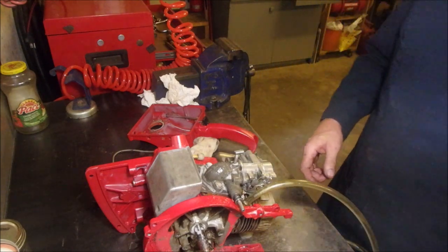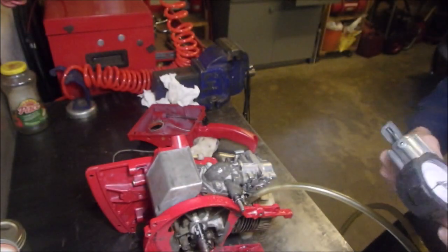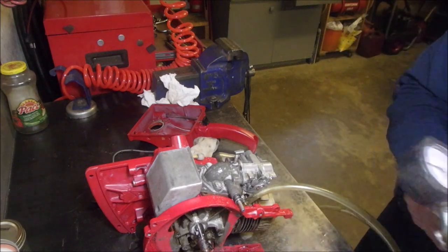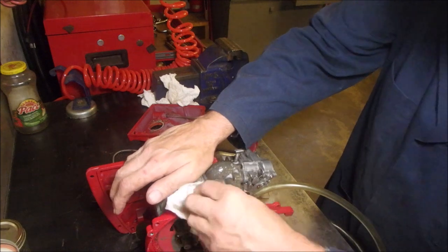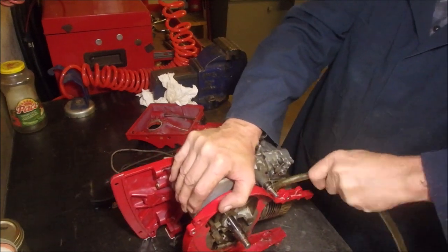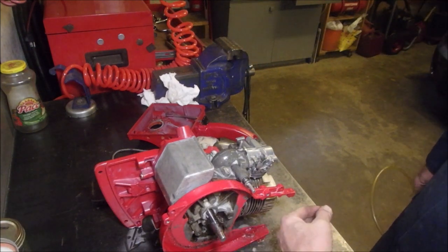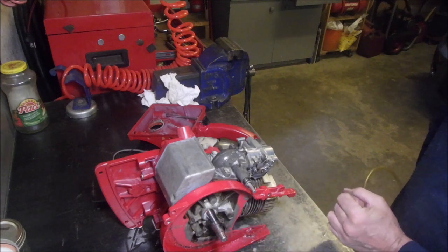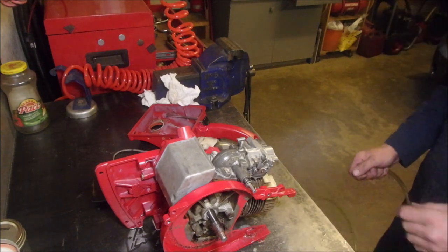Now which one do we unplug so you can hear it? That's quite a bit of air in there. I'm happy! I can assure you that the air pressure in here is changing all the time — that's what two-strokes do. The piston goes up, it compresses the cylinder, and at the same time produces a vacuum in the crankcase. When the piston goes towards top dead center, it creates pressure inside the cylinder but also provides a vacuum in the crankcase. Then when the piston goes down, it provides pressure for the vaporized gas to get up into the cylinder.